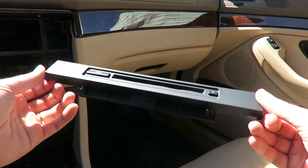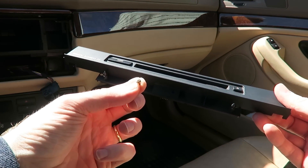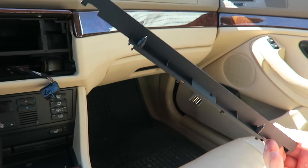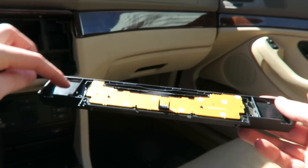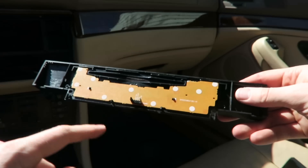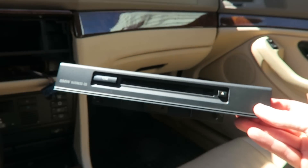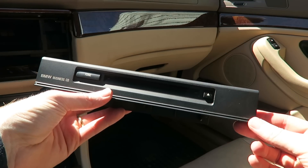To remove the trim, you're going to need a very small Phillips screwdriver. There are two small screws on the sides of the cover that you need to remove. Then you'll need a very small flat head screwdriver — micro size. Go all the way around the edges of the cage and faceplate; there are about six places where you need to pry and free up the tabs to separate the plastic cover from the metal CD player. The buttons on the old one are much nicer and clicky.